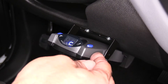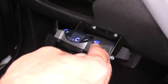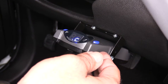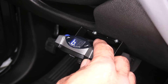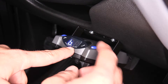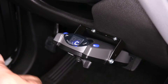Boost mode is going to change the quickness and aggressiveness with which our brakes are applied. For a light trailer behind a vehicle we really don't need any boost, or maybe just boost level one. But as that trailer gets heavier or as the hills get steeper, we want to increase that boost level to get a quicker, more aggressive braking process. We do that just by tapping the button. Currently no boost is on — we hit the button and it shows B with no number. We hit it again and we go to B1, B2, B3, and back to no boost. Very quick and easy to adjust, and it really helps you fine-tune your braking. Once we have our gain set — the maximum power — we can set the feel, or how quickly and aggressively we want those brakes to come on.